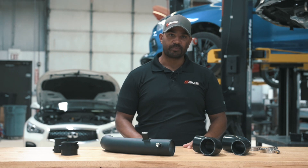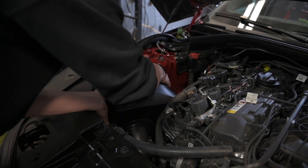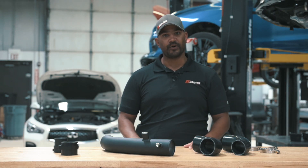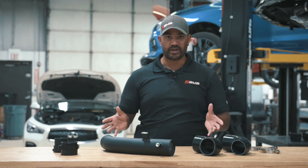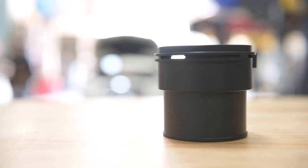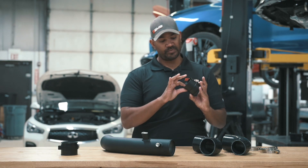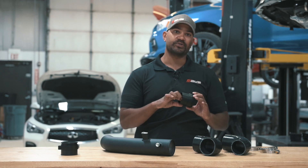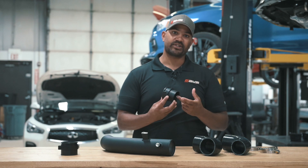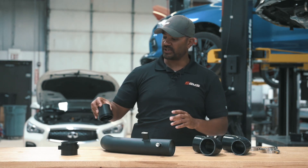Not to mention the stock turbo is actually a pretty tight package. So a lot of trial and error there to get it easy and simple, kind of cost effective, and still maintain the function and general spec we were looking for. We start coming out of the turbo with this flange. It uses the stock clip, the stock seal, and it has a nice smooth transition on the most important part, which is the inside radius. Just like a corner at the road racing course, you want to maximize that radius as much as possible — that's going to reduce the pressure drop and keep efficiency up.